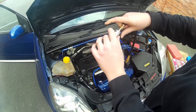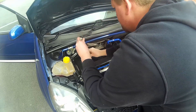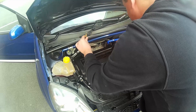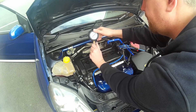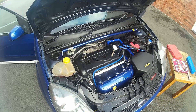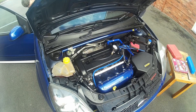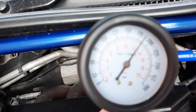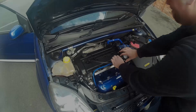Now to wind in the extension — poke that down into the bore, make sure the threads are nice and clean first before you pop it in. Give it a twist until it seats nicely, then make the push-fit attachment onto the pressure measurement device. This device reads in PSI and you basically turn the engine over maybe four or five times until the pressure gauge reaches its top position. Keep your eyes on the gauge — you can see the needle jumping round. The moment of truth: that's pretty good, a little bit more than I was expecting for an engine that's done about 70,000 miles, but pretty good.